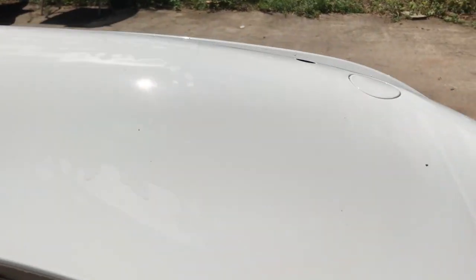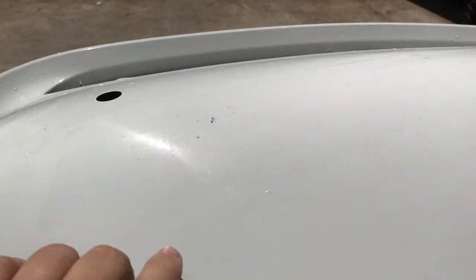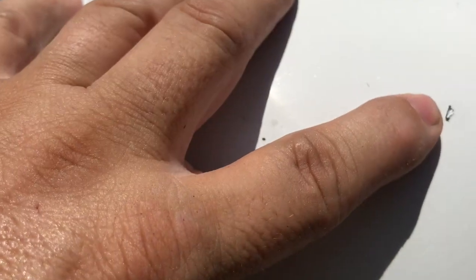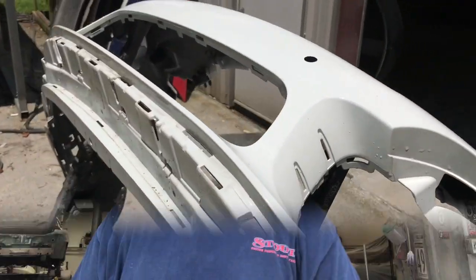Sanding with 600 may not work for what I need. As I started sanding I can see little black specks — rock chips down to the plastic — and there are a lot more than I initially thought. He had a lot more touched up and you couldn't see them. Little gouges that won't sand out with 600 will probably show up when I repaint, even with sealer. So that leaves us priming this whole bumper. If I'm priming, I'll sand it with something more aggressive — 180 grit on a DA — get it all sanded down, and the rock chips will be gone before we prime.